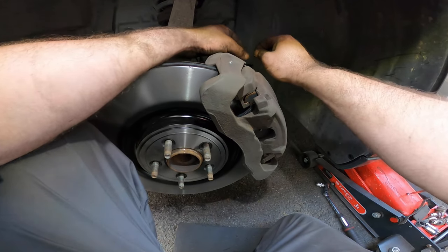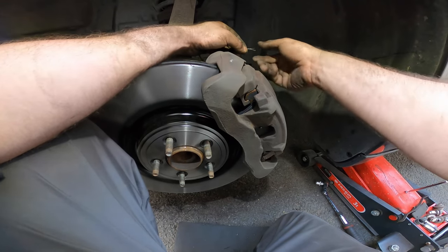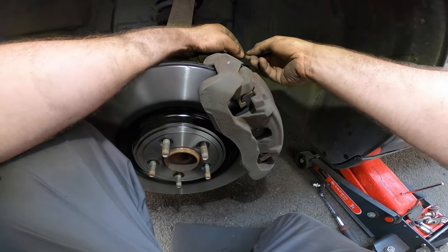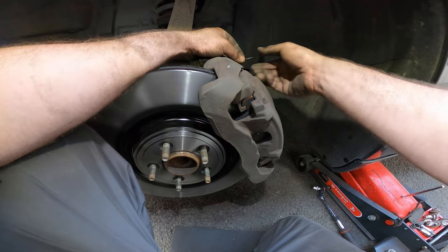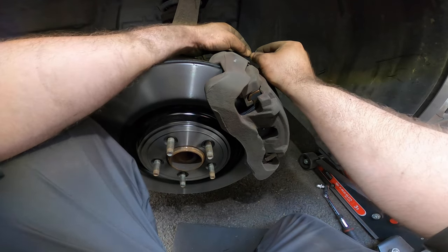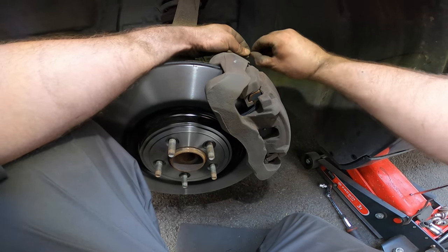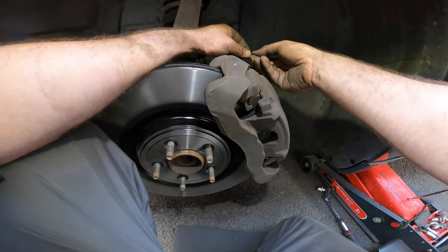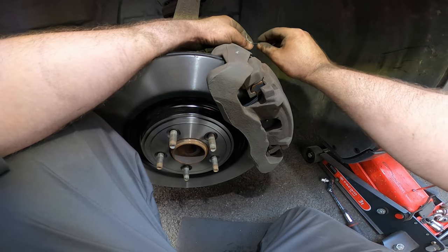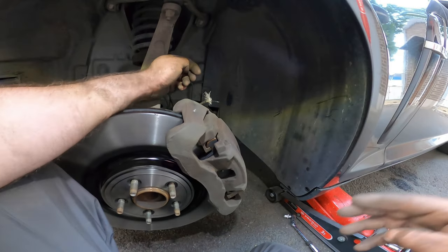Kind of cool. Yep. Now we can twist the wires, solder them together, and the message on the dash will be gone, even without the reset, I think. But we'll confirm that a little bit later. All right. So these ones are pretty fine. I'm gonna push them together like this. Double the fun and solder the point and then put some tape on there or some shrink stuff.